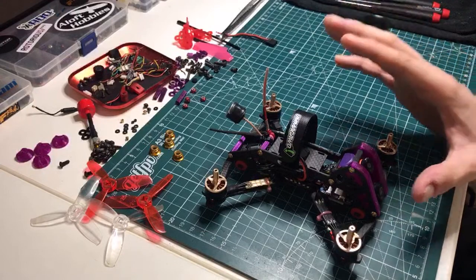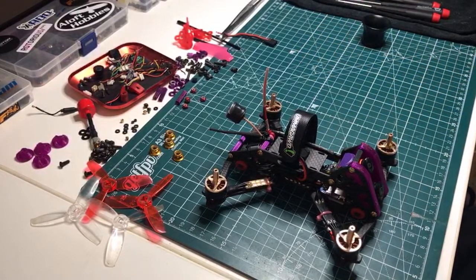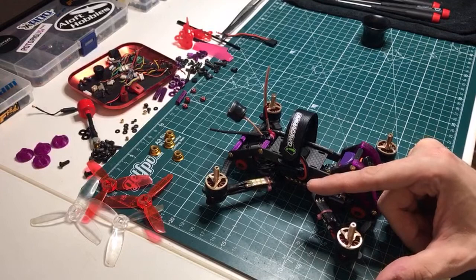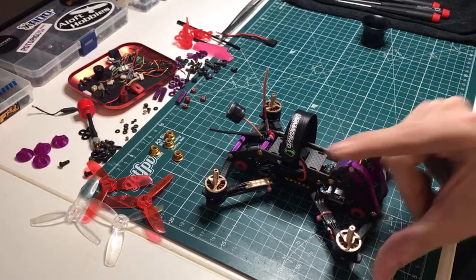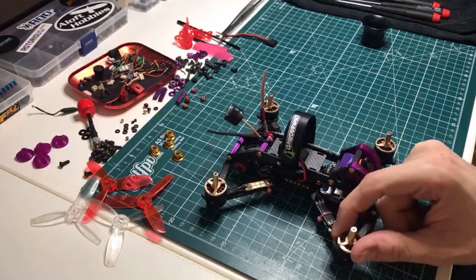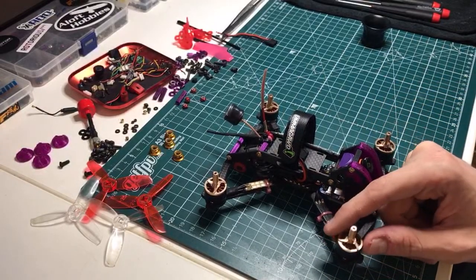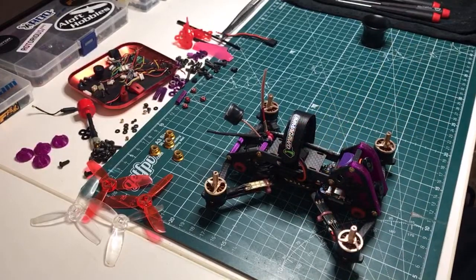And I've been talking about this for a long time, and I guess somebody finally heard it, and this motor has a wider stator for a little bit more torque and less stator height. So it's wider and shorter. What that'll do is give you more mid to low throttle control of the prop because it has more instantaneous torque, so it can spin up and slow the props down quicker.